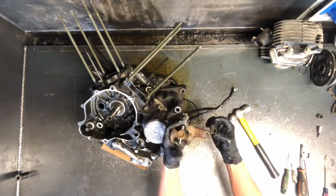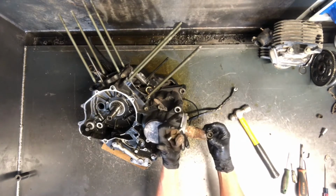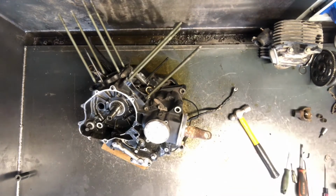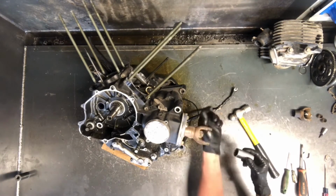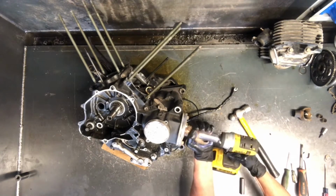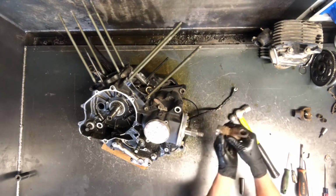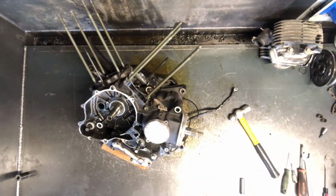And if you're wanting to replace this joint, what I'd suggest doing if you're having to take this off, because these are $15 to $20 for a good one, and while you're there, you may as well put a new one in there. But because we've done other videos on this, I'm not going to go into detail on replacing that joint. We just need to remove this bolt here, or this nut. 7/8 nut there holding this yoke set on. Pull that out, you've got a spacer there. I'm going to set those together.